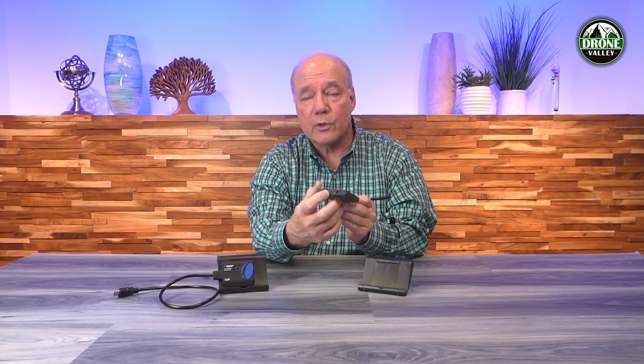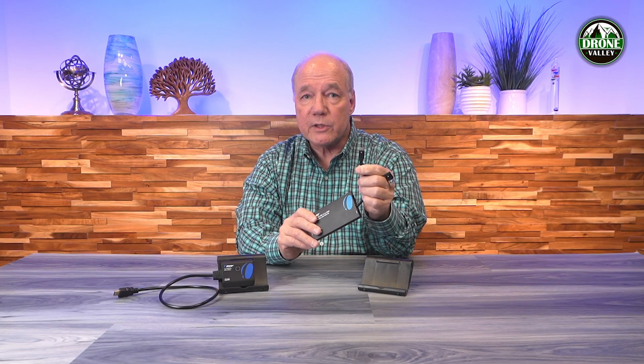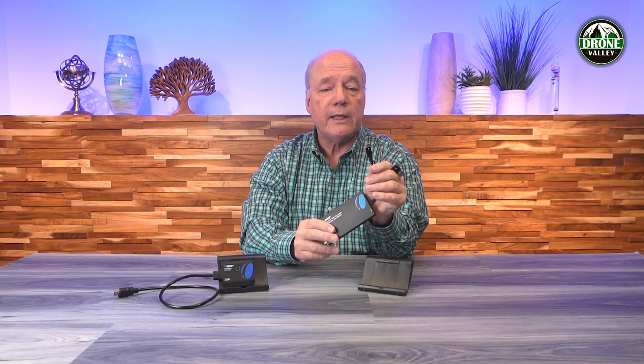Next I'd like to take a closer look at both of these and explain the connections and indicators to understand how to use them. I'll also do a quick demonstration to show you the basic differences. And with this Split Extend unit you can connect two external monitors, and there's even a USB-C port right there that I can connect up to my power supply. So through that single USB-C port, I'm not only extending my monitors externally, but I'm also charging the laptop through that same port.